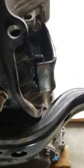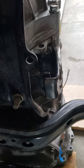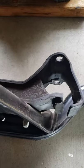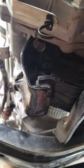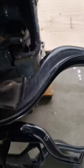I noticed on the actual bushing mount, this does seem to have — it's not as squishy, it doesn't move as much. You can see it moving a little. As for this STI one, I can move it by hand pretty easily without it even being bolted on — it moves a lot easier. It seems like this Group N that I bought is more firm than this, even though they look very similar. And this one was bent when I got the transmission. It's supposed to be more like that instead of like that.